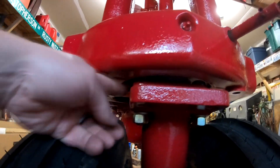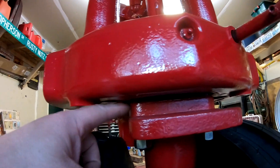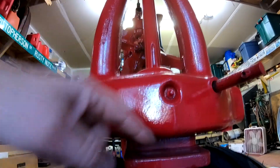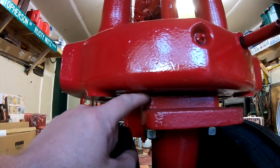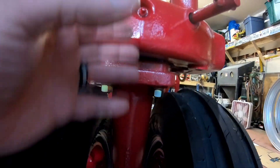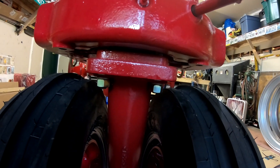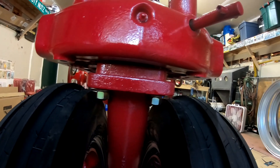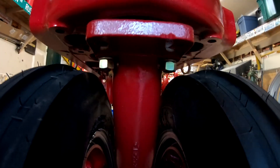Essentially, I dropped all four bolts in from the top. You can do so by rotating this top plate, which is connected to this shaft here. It comes down through the bolster and out the bottom, and that's what your pedestal bolts to. I dropped all the bolts in, had the front end raised up, then just kind of weaved the wheels and tires and the pedestal onto the bolts and loosely applied the nuts. And here we have it — it's not real complicated.